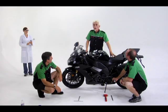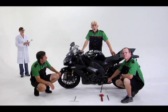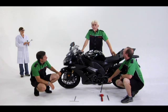While the spring is responsible for how quickly or slowly the forks and shock compress and extend after hitting a bump, there is also another level of control. As they move up and down, the oil inside provides resistance to the motion. The damping adjustments on your bike are like a common water spigot. When you open them up, they allow the oil to flow more easily inside. This provides less resistance and allows the spring to compress and rebound rapidly. Closing them down restricts the flow.